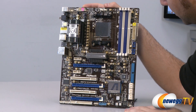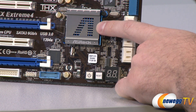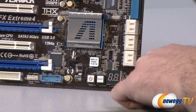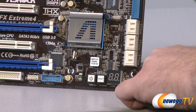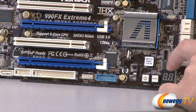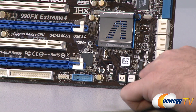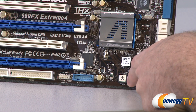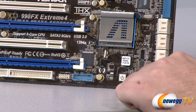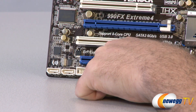Now let's go over the details of the board, starting in the bottom right. Here we can see the heat sink for our Southbridge chipset — that's an SB950 Southbridge. We also have some front panel connectors: a power LED and speaker header here, with the rest of the front panel connectors over on the left. There's also a debug LED — great for troubleshooting if you're having a tough time getting it to POST. We also have surface-mounted power and reset buttons, and the USB 3.0 20-pin header which you can use with the included bracket. And here's your floppy connector and COM header.